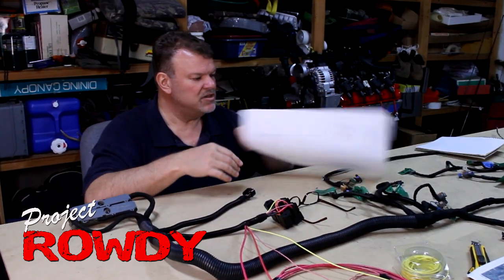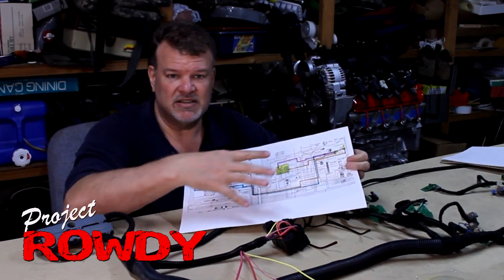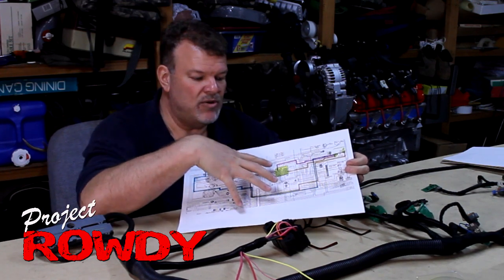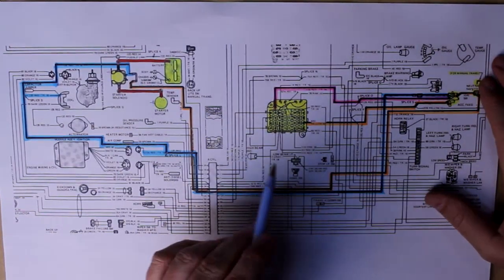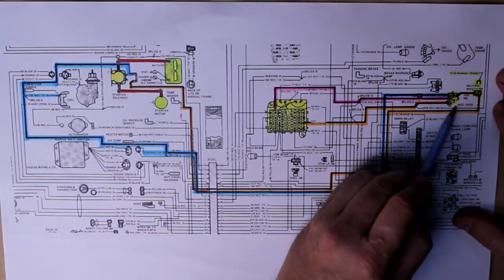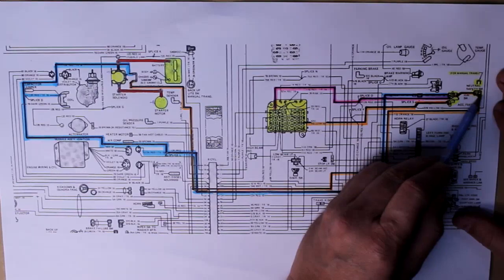I found an old wiring diagram for my Jeep. I'll zoom in and walk you through it — it looks cumbersome but if you divide it into little pieces it's pretty simple. Here's a zoomed-in view of the relevant portion. The components we need to consider are: the fuse block for the Jeep, the ignition switch, and the neutral safety switch. If you have an automatic transmission you'll have a neutral safety switch; for manual transmissions they just use a jumper to close that switch, basically as if the switch isn't even there.